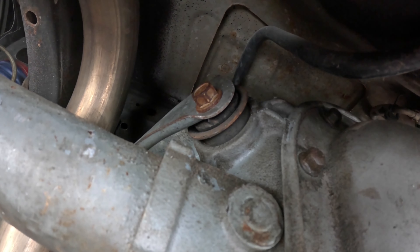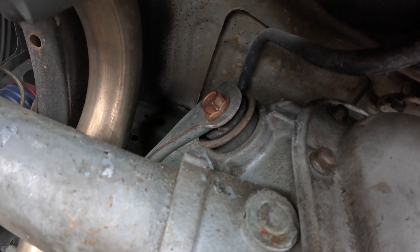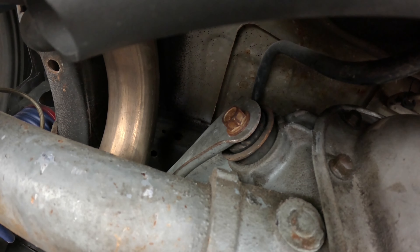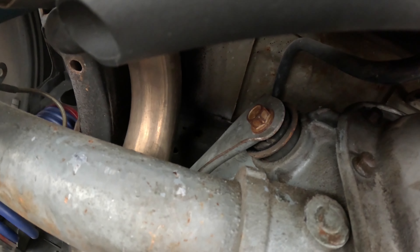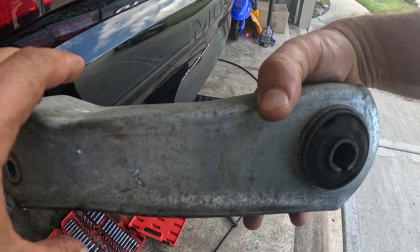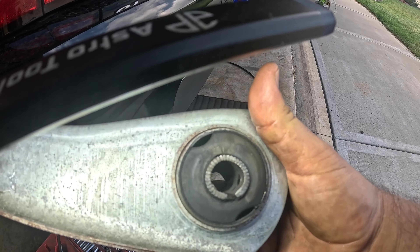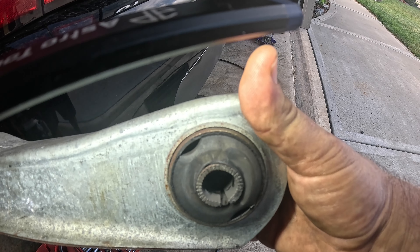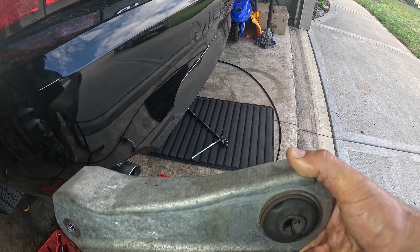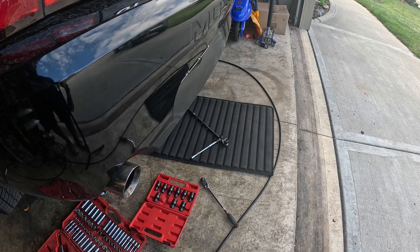When the differential moves laterally it actually pushes the front end to one direction or the other, making the car very difficult to drive. I haven't yet decided whether to just replace the control arm — the easy button — or go with the torque arm. By the end of this video you'll see what I decide. So there are two contributing factors: the main one is the upper control arm, and this bushing that connects the axle to the chassis — that inner sleeve has just completely come apart.